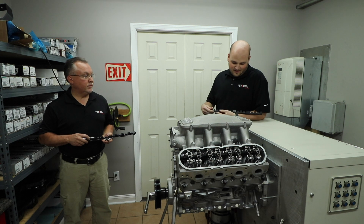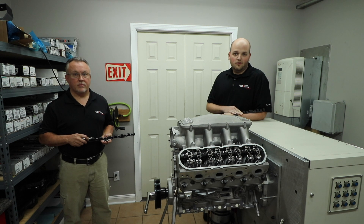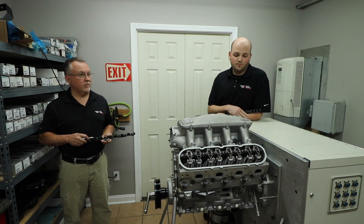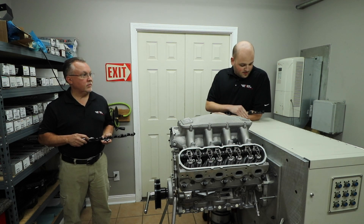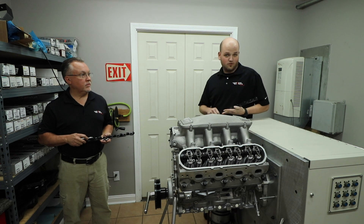We'd had really good luck with our V2 trunnion with the 52100 steel, like Brian was saying, and we knew we were going to use that for the shafts for sure. We also wanted something that was affordable, used the stock rocker, and something that we could sell to a customer and they can assemble it just like they do our trunnion kits now, which are a big seller. That was pretty much the idea and the ideology behind it that created the BTR shaft rocker system.